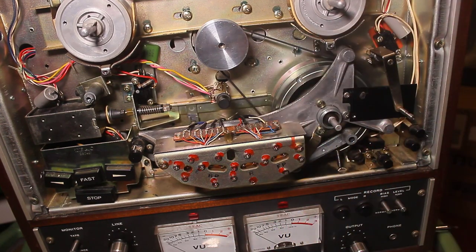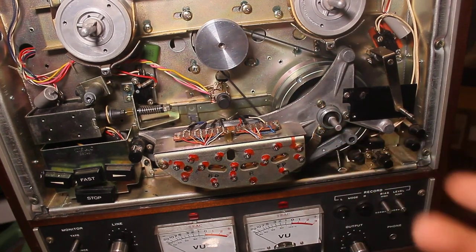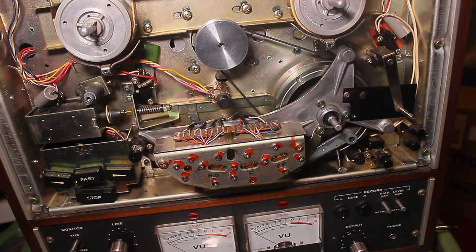The other order of business is the pinch roller mechanism that makes it grip onto the tape — that's a frozen mechanism. It doesn't take much force to manually click it up, but it is an inconvenience. There are two methods I've heard of for fixing that: the source I'm linking in the description had the same issue with the A model. The methods are either using heat, which is quicker, or using a penetrating oil like WD-40. I decided not to tackle it today — I just wanted to get the belts in.